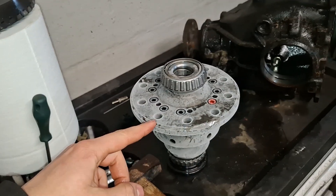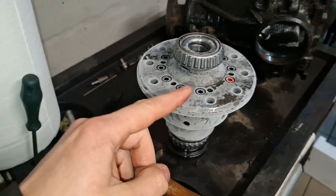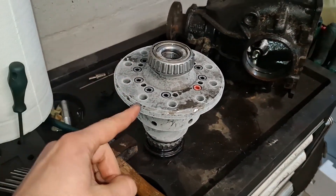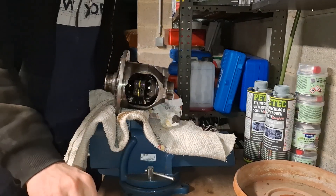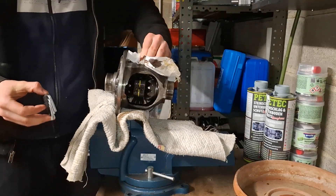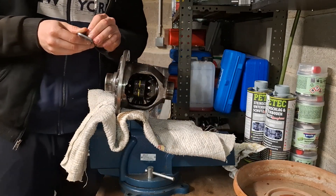This thing is seriously cold — I had my freezer set to minus 25 degrees Celsius and I heated the bearings up with a hairdryer. There was like 40 to 50 degrees C of difference, meaning the press fit can be done easily with a small hammer. As long as you do not touch the outer race with the rollers or the guard, you should be fine. The gear ring does not want to go on — it's too cold, so I need to heat that up as well. While waiting on the ring to heat up, we can disassemble this thing even further and check the state of the conversion set.